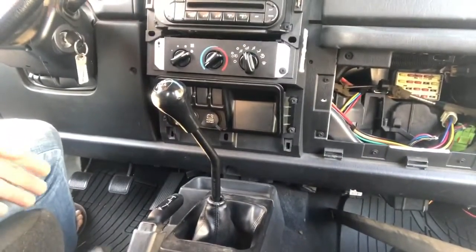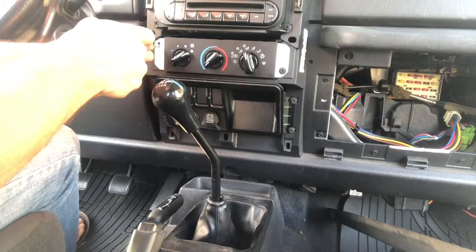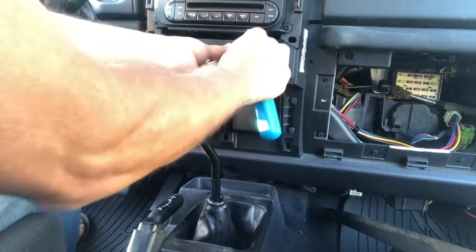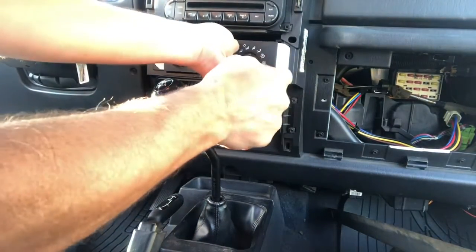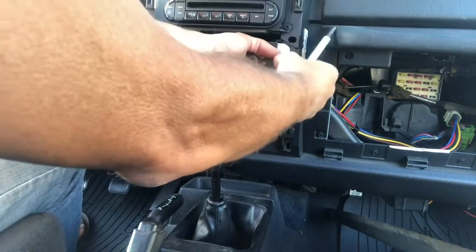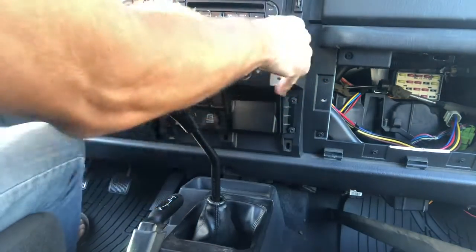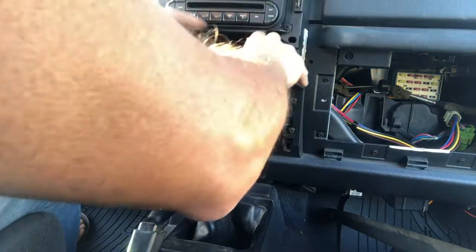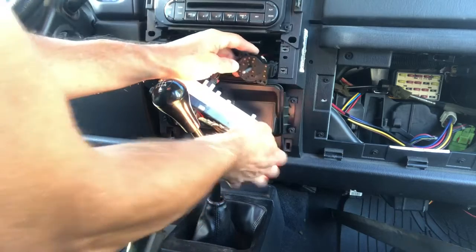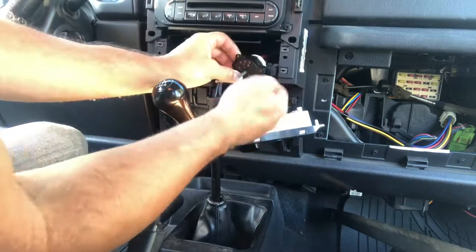In my particular case, to get to the back here, and this is some of the wires for it, there's a Phillips screw here, and then there's one here. So let me pull that off, grab this here, remove that. Pull that off here. And when you open it up, you will have all these switches here. And let me unplug this here. This is the culprit in my case. This particular switch is what runs your blowers.